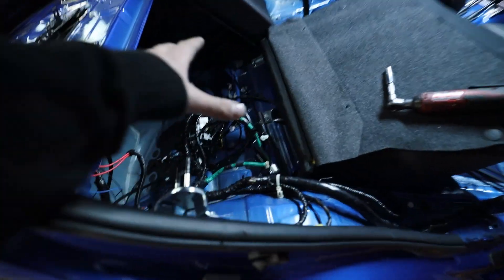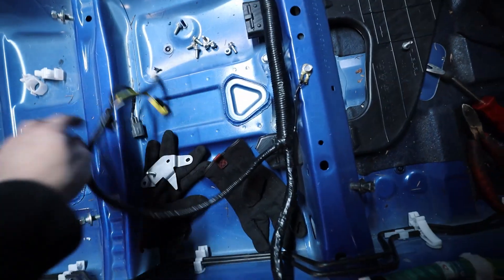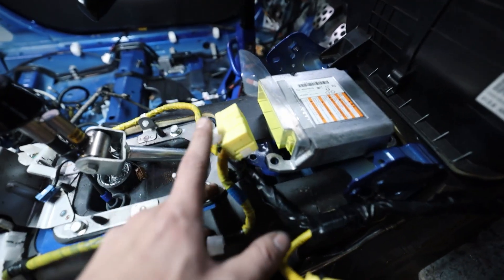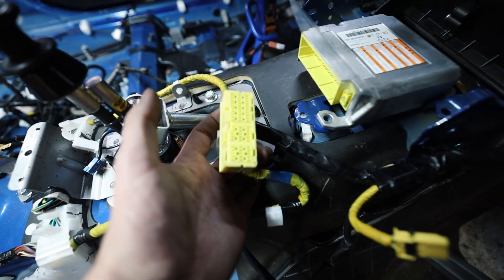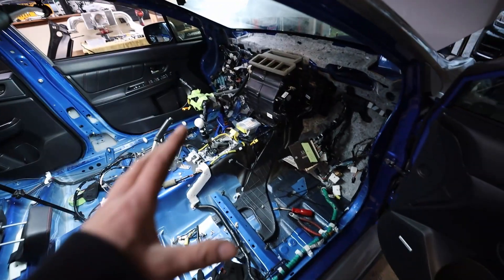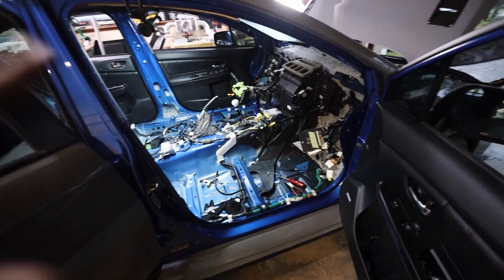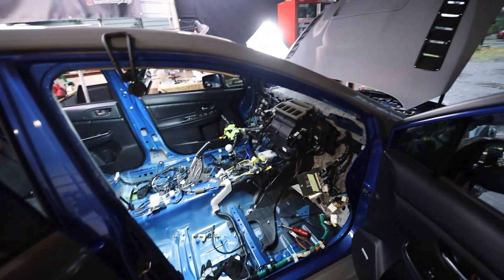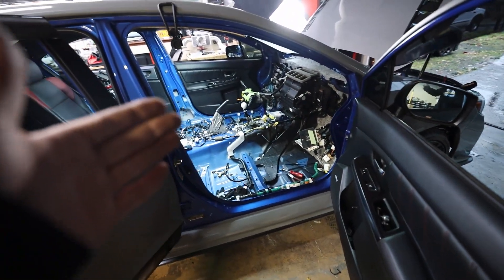The passenger side of the harness is up into the trunk area, following where it ran stock. It comes up, jets across, goes up, and then sits in that little cubby for the seats — I'm just going to tuck that away since we're not using it. This connector here does not match — the 2017 connector on the SRS module is larger than the 2016 one. I don't think that's going to prohibit us from what we're trying to achieve. We're trying to retain as much OEM functionality as we can. We have a Haltech digital dash in the car, so it's going to cover up any warning lights anyway.